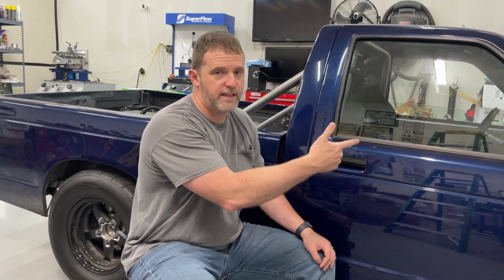Even when you look at your weather corrections, like when I raced, it was 74 degrees. I posted the data log, and if you looked at the data log, you would see something called MAT. That's manifold air temperature. Well, that recording, because I don't actually have the sniper on, the sniper is really close to where the air cleaner is, and that's where it's gathering its air. If you look at the manifold air temperature, it's not getting 74.3 degree air. It was getting 105. So even though the weather correction says one thing, what the engine's actually breathing in isn't that. Now, of course, if you had an open scoop and it was facing forward, that would be a different story. That is not what this has.